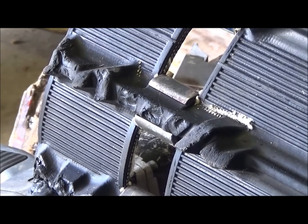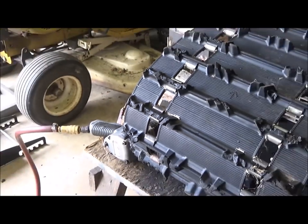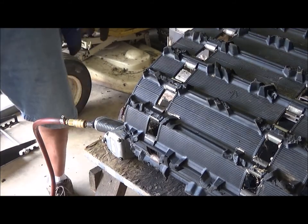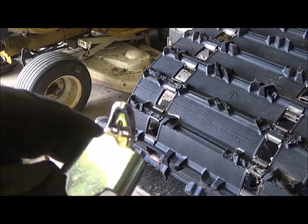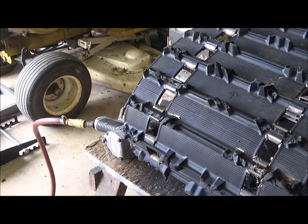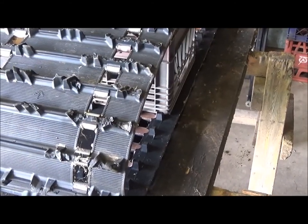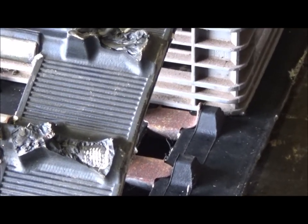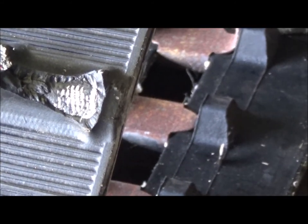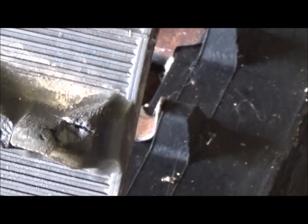That's what it takes to put a clip on the track. These are guide clips that I'm putting on — the other ones are just regular clips that don't have this little edge on it. You can see that edge there. The hyfax will run right up against that so that it will not hit the rubber lugs. If you look inside the track there, you can see one. You see those rubber lugs? You don't want your hyfax rubbing up against them because it will eventually wear them off. You don't need it on every clip — it's every fourth clip on this particular track.